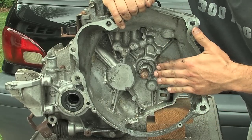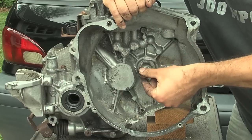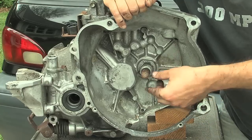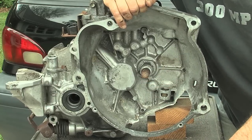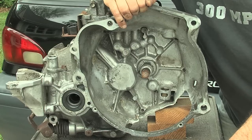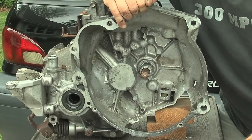In the engine version of the vehicle, this shaft would have come out further and would have been supported by the flywheel. So one thing we do need to make sure is that with the coupler, the other end connects solidly onto the electric motor so that this shaft is supported by that.